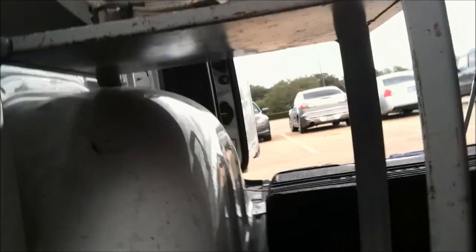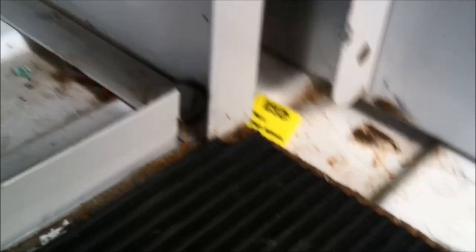Okay, let's take a look at the shelving now. First, let's take a look at this little water stand here. It looks like we've got bolts that need to be loosened underneath the van. We've got a little Phillips screw right there connecting that. I think that's it — three of them — oh, and there's one in the back on the wheel well. For the shelving, there's a bolt going underneath, there's another one, one in the corner, and one right there. And it looks like it's actually connected to the partition.